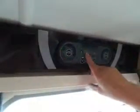So power — that's your switch for your 12-volt systems on and off. That's your water pump on and off. That shows you've got 240 connected, and that shows your leisure battery connected. Press 'view level' and it shows your leisure battery status. It's showing 14 volts at the moment because it's going through a charger — if you weren't connected to electric you'd run about 12 to 13 volts.